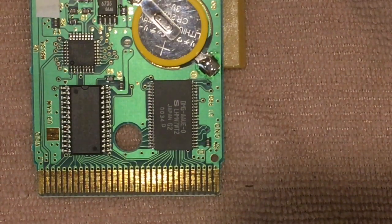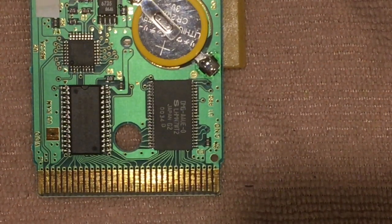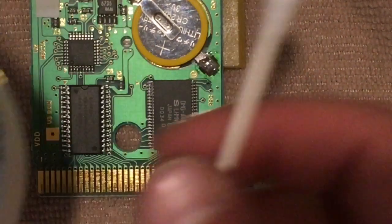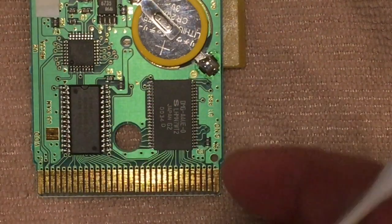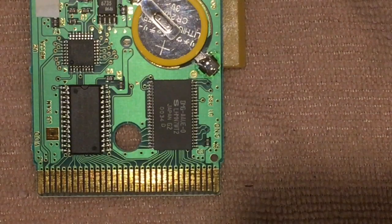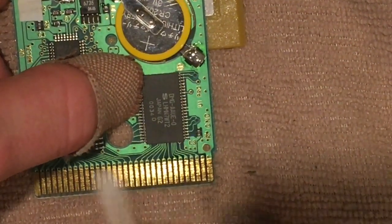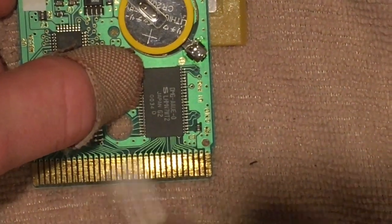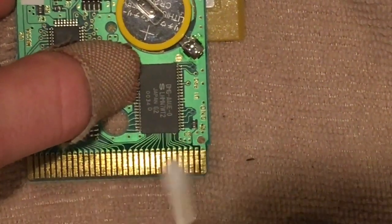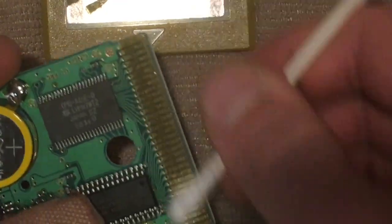While I have the game open, I'm going to use this as a great opportunity to clean those contacts, because we're talking about a game that's probably about 15 years old. Over time it's gotten a little bit tarnished with oxidization — it's not necessarily rust but it's dirty and it's not going to read properly. To do this, all you need is a Q-tip and a bottle of 99% isopropyl alcohol. Dunk your Q-tip in the alcohol and just start scrubbing. Unless it's really bad you usually don't need more than this — just scrub off any loose stuff to make sure that when you insert it, it's going to read every time. Once you've given it a good scrub, use the dry end to buff it dry. This also helps to remove any residue left behind.